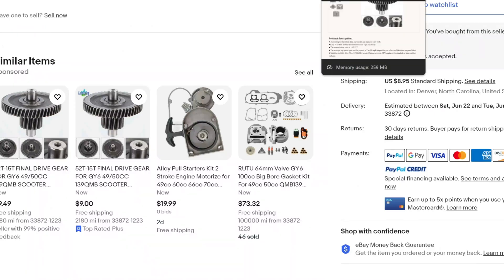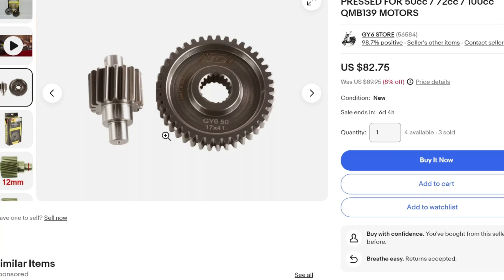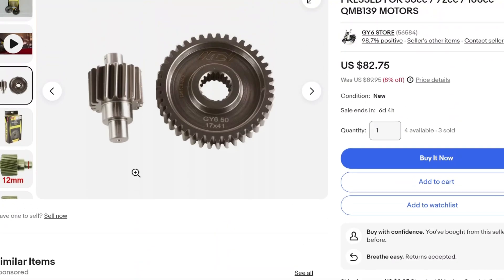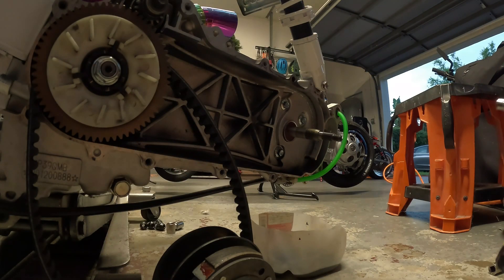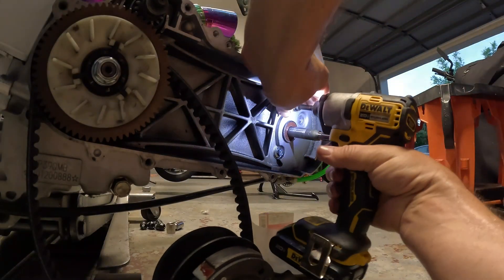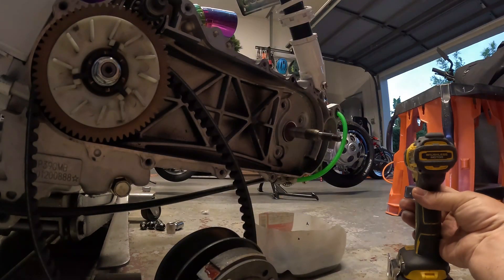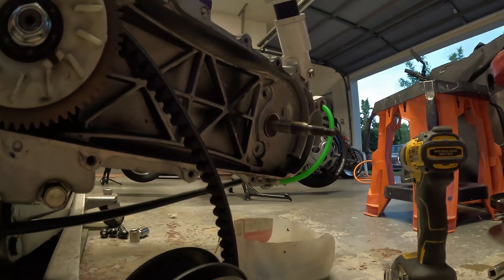Here's the problem: I'm currently doing 8,000 RPM at 50 mph. If I gear it up I might only reach 7,000 RPM, or I could gear it down and get 9,000 RPM — but I'd still be going 50 mph because the gearing is different, so I'd need 10,000 RPM to get more speed. Let's start by making an educated guess of what our gearing is without taking the thing apart. Nobody wants to have their bike torn down waiting for parts from China — so we're going to break the code on how to tell what gearing you have without disassembly.